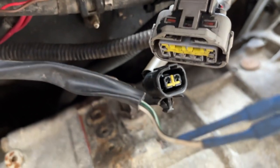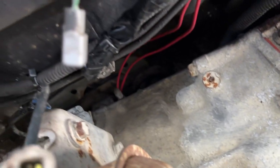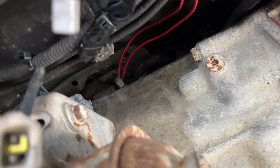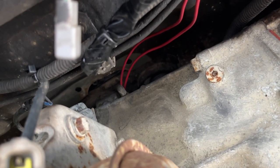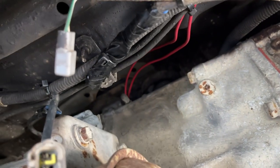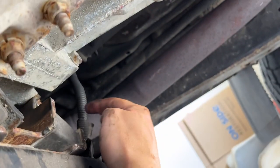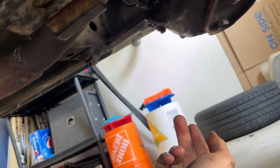So we have reverse and the truck starts — that's all. One thing I had was the electronic speedo, which I was lucky with. That was plug-and-play from the automatic to the manual — it's just a three-prong plug on the tail shaft of the transfer case, and it just plugs right in. You'll notice your O2 sensor wiring goes over and down across the crossmember to the O2 sensor over there.